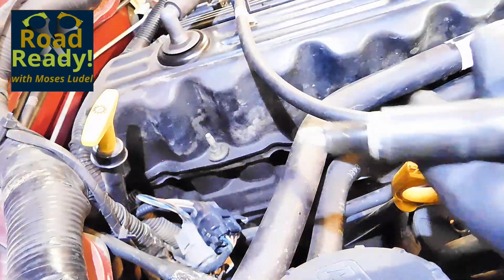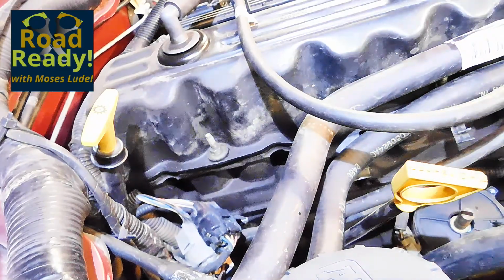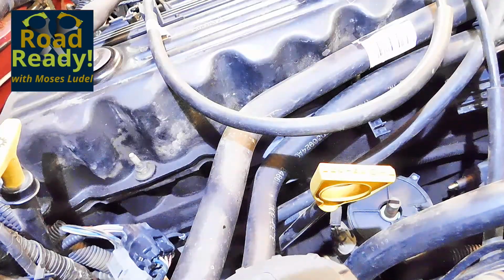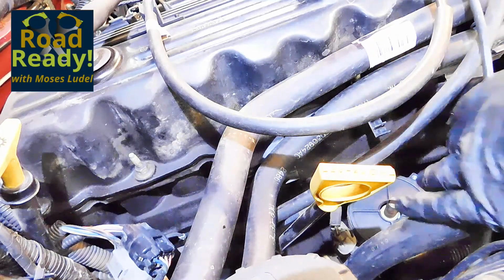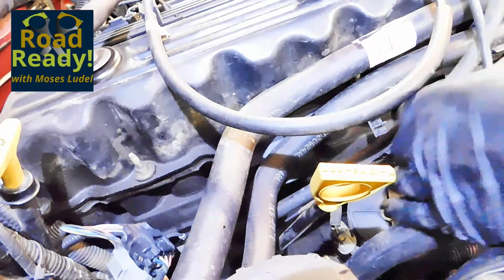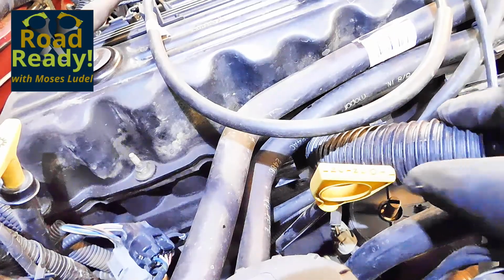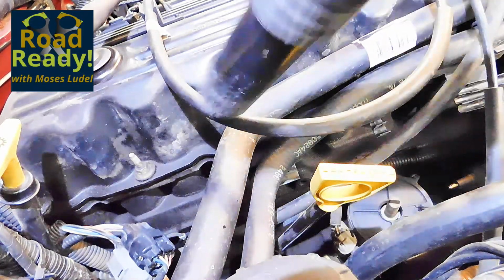In my experience, air impact tools can often have less damaging effect than hand tools, especially with aluminum cylinder heads and removing spark plugs from an engine like the Ford Triton, which has a history of problems with spark plug threads. The Jeep 4-liter is among the last engines to have both a cast iron block and a cast iron cylinder head. Thread integrity is not as much of an issue as long as spark plugs are threaded properly into the iron cylinder head. Here goes another round with the vacuum cleaner,